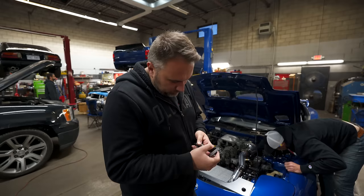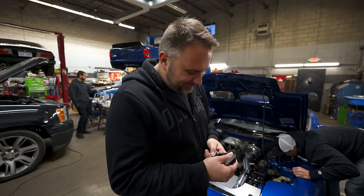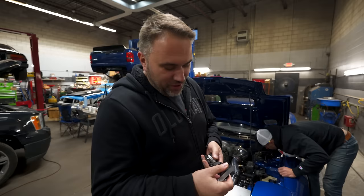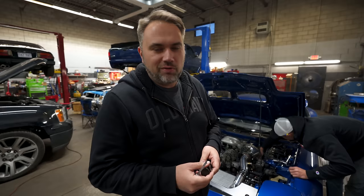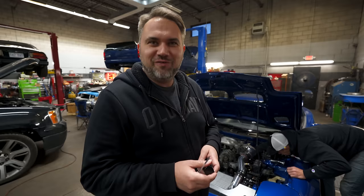We're having a little bit of an issue with the mid-range. It's sort of grumpy. It's not making a whole bunch of power there. So we are gapping plugs down to see if that's our issue. Essentially, what we think is we're blowing out spark, and it's just causing the car to not run that great in the mid-range. As we get past about 5 grand, it becomes smooth. So this is our last-ditch effort before we call it.